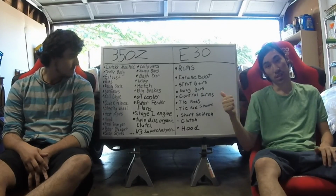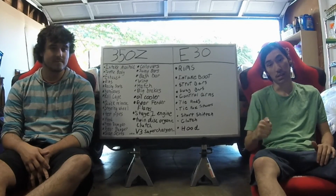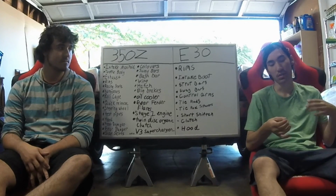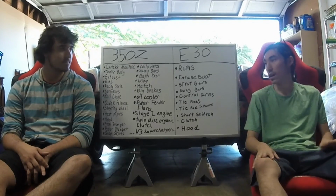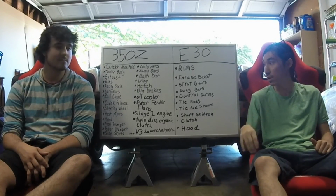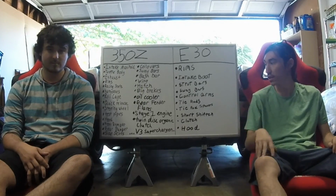Wheels and tires, because there's 16-inch rims on there right now, and it's really hard to find a good affordable tire in 16. So I'm actually going to go up to 17. Most people would stick with about a 15, like 14s were stock, so it's going the bigger route, but it shouldn't be too out of hand. And with the coilovers, I'll be able to make it not look too dumb. Next, my intake boot is ripped. It's the rubber intake boot, so I'm going to upgrade that to a silicone one, and then the intake should be sorted out. Idle's all funky, just all bad.